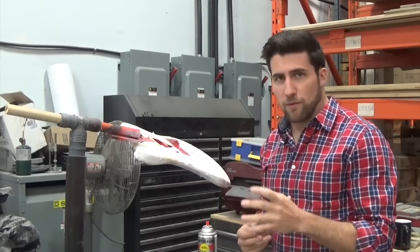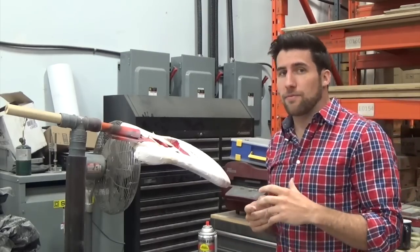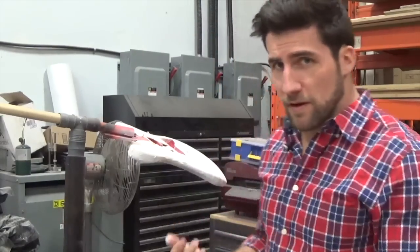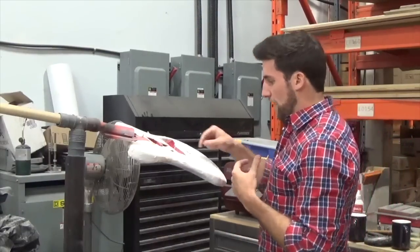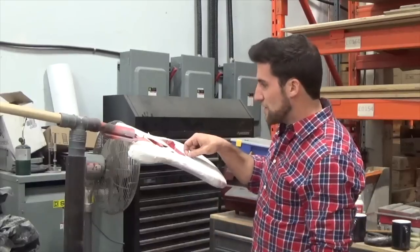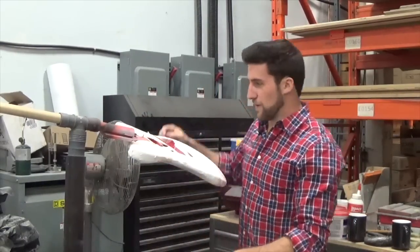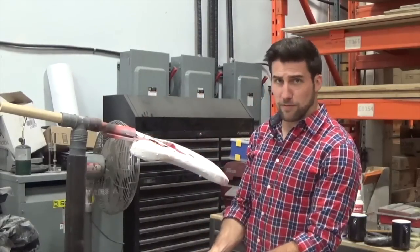I'm going to go through and do one more coat but it'll be the exact same thing, so I won't bother filming that. Then I'll let it dry and it'll be time to unmask. It's only been maybe five minutes since my last coat, but matte paints tend to dry very quickly, so I'm going to carefully start peeling the tape off - I'm curious to see how the pattern turned out. Do as I say and not as I do - let it dry more before you peel.